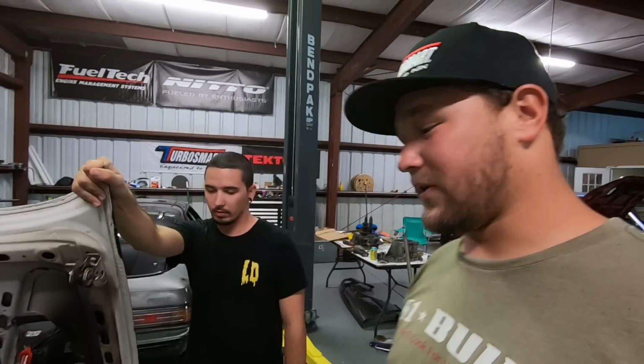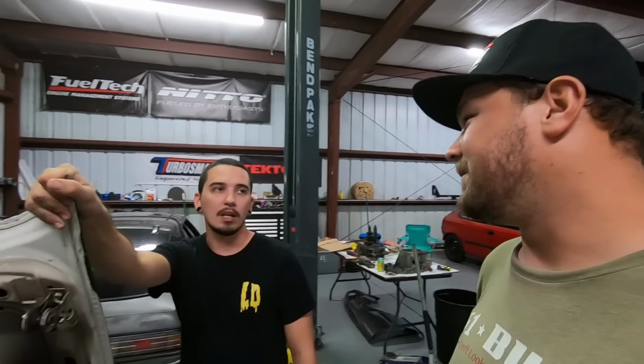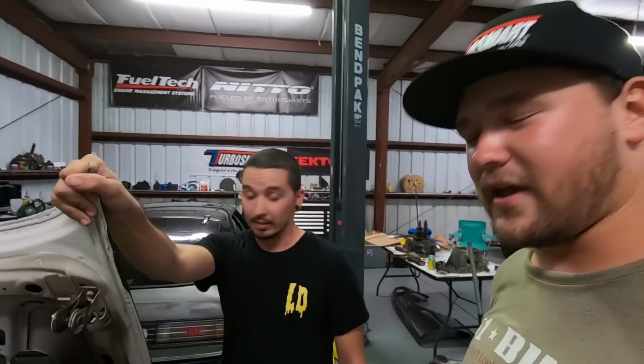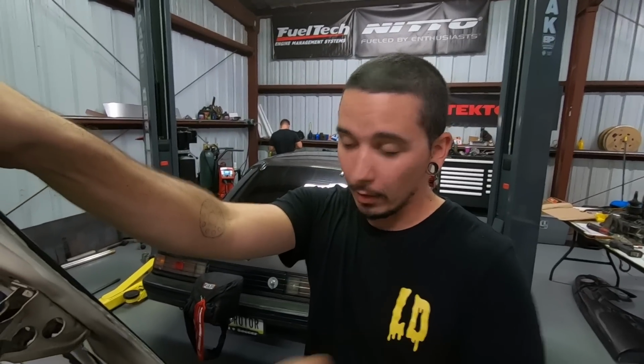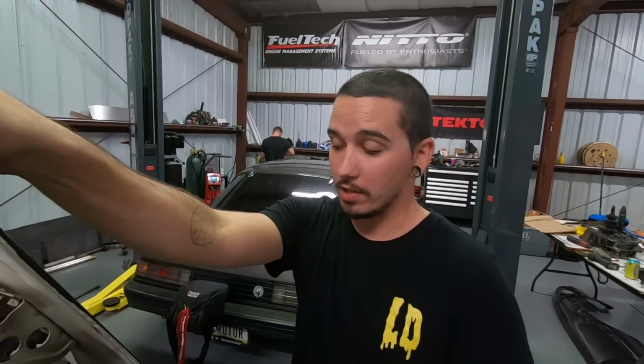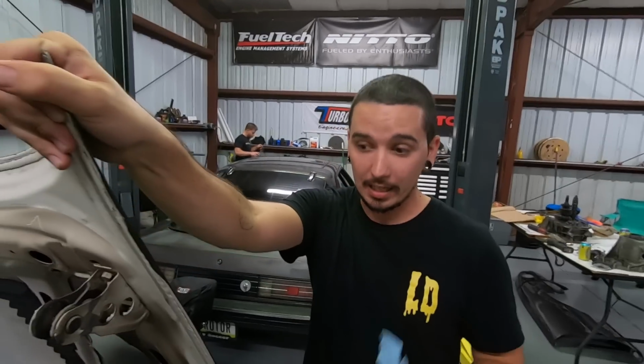I didn't expect it to have as minimal of issues as it did. No. Especially at that power. I'm surprised it hasn't hung a rod yet. Tuning the idle, I thought it was going to be a nightmare, because of the 1400cc injectors. Right. Big thank you to Snake Eater again for the pumps and the injectors. These things are incredible. No BS here. There was not a lot of tuning going on with those injectors. We literally plugged in what Snake Eater gave us, and it idled. Runs good. All we had to do was up the tip-in a little bit, and it's been solid. I can't complain.